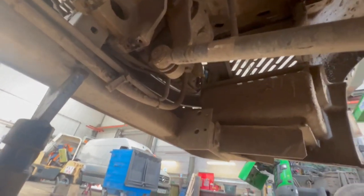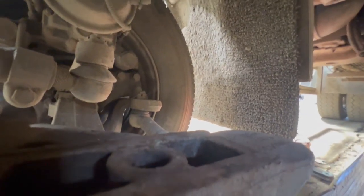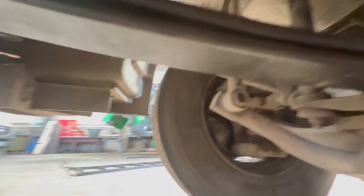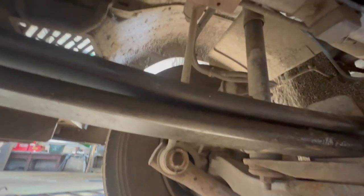I've just currently lifted the spring back off because I couldn't physically get the clamps on with the drag link there, so I just lifted it back down and put them on the floor. You've got a little pip hole here - just clean that out - then your shocker bracket here, there's a locating lug that sits on top of the axle, and your spring sits on top with a locating lug for the spring as well. Spring's on - brackets on, you can see how they clamp that pin. Two U-bolts, four nuts hold that on.